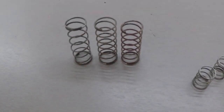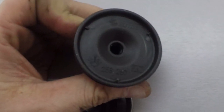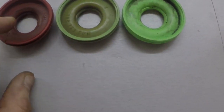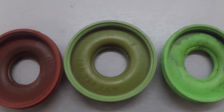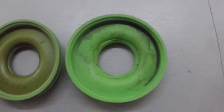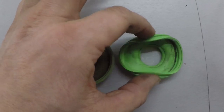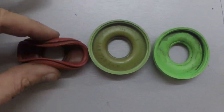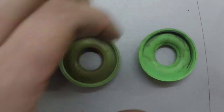There are different styles of these caps as well — this is an aftermarket one, this is an OEM one with the Rotax name on top. Ideally I'd like two of the OEM ones, but if all I have is these I'll keep it consistent — that's the main goal. Same thing with the bellows: you wouldn't want to mix these together. This is an original Seadoo 951 bellow, this is a replacement Seadoo bellow, and this one is a third-party aftermarket bellow. The reason we want consistency is the material they're made out of is different — this one is harder, this one is the softest, and this one is in between. I'm going to use the matching OEM ones since you can't get these anymore and I'd prefer not to use aftermarket ones.